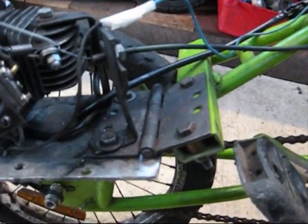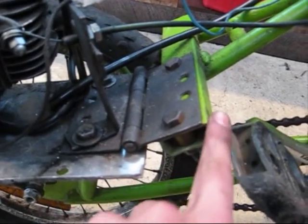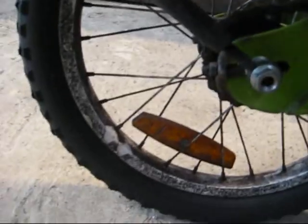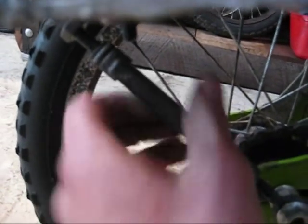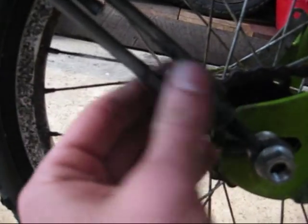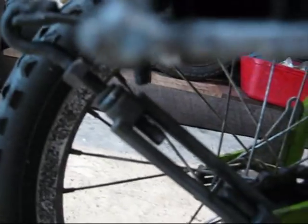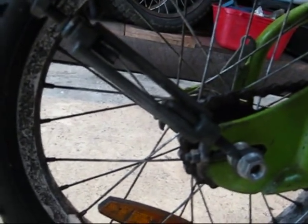It's attached with this hinge to that frame, to that little cross piece there, so that allows it to go up and down. Down below it's got this turnbuckle, which you probably will see in my other video. What I do is I turn it down to get it onto the wheel, then when it's at the right height, I lock this nut here with just a spanner, and I lock this nut up here with a spanner, so that really locks it down. I was having troubles with it coming loose while riding, so I just did that and that stops it.